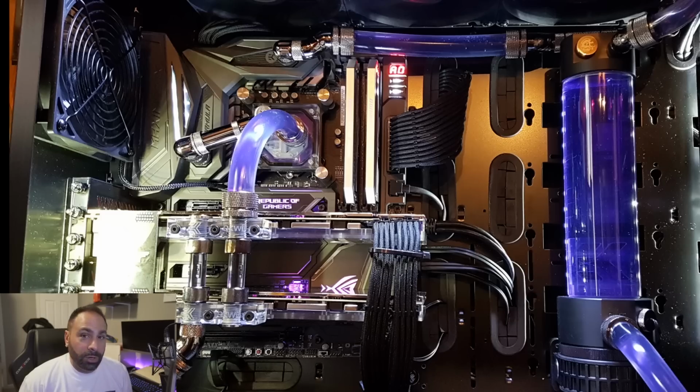First of all, as you guys are probably aware, I'm not a huge fan of plugging in PWM headers in the middle of the board. I always tend to find a way to route them back up through this EPS cable grommet back here, and then plugging it in either via a splitter or directly into the motherboard some other way. But this is personal preference, I suppose.